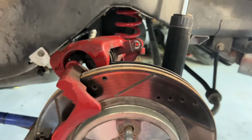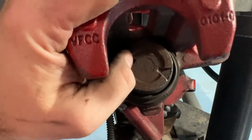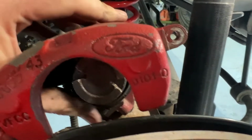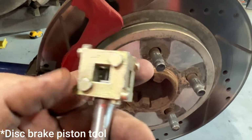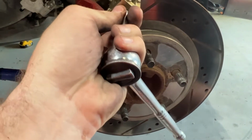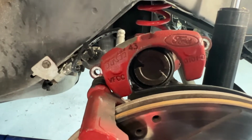So as you can see, this guy is giving us way more trouble than we expected. This boot is basically shot, but you'll see that there are two grooves on that circle, one on the right and one on the left. Those grooves, in order to unscrew this, we have to use a special Dr. Strange looking tool. Each one of these sides is meant for a different thing. Right now we're using this ratchet and getting these two blocks to line up in those little indents.